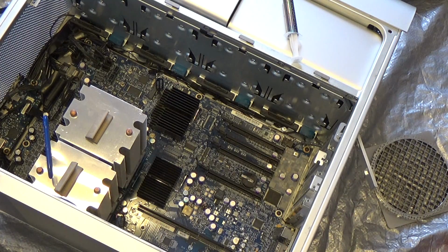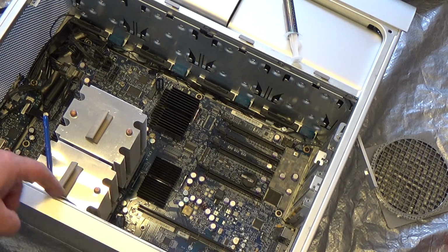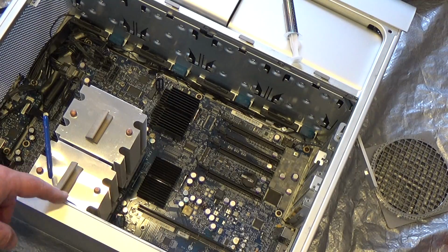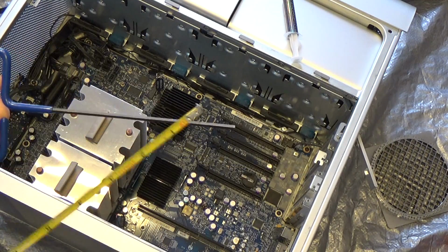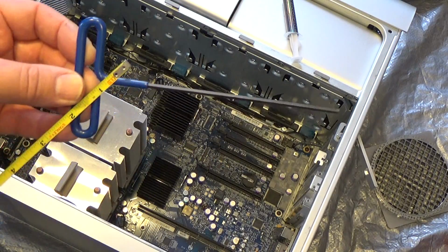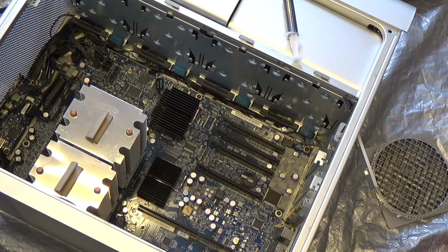And then you've got this side of the case to deal with when you get to these inside ones here, these inside here and here. A good 2 more inches, I would say at least an 8-inch T-wrench from here to here. At least 8 inches is what you need to efficiently take these up. I did get them on and off, but it wasn't easy. If I had to do it again, I believe I would try and find a longer 3mm.